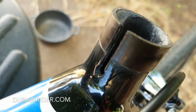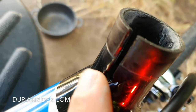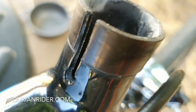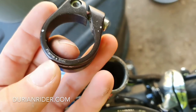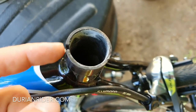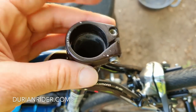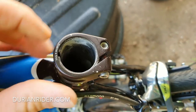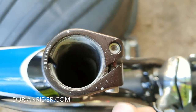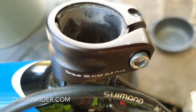Things might crack but they don't get bigger than that — this one looks fantastic. On these SLs, back in the day Specialized did a lot of good instructions. This is the frame slot — it's been designed like a bit of a beak, a bit of a cape, and that just slams down and you're good to go. Line up with the frame slot and you tighten these up to about five or six newton-meters. It always says on the side — there you go, 6.2. Use a torque wrench if you're not experienced.